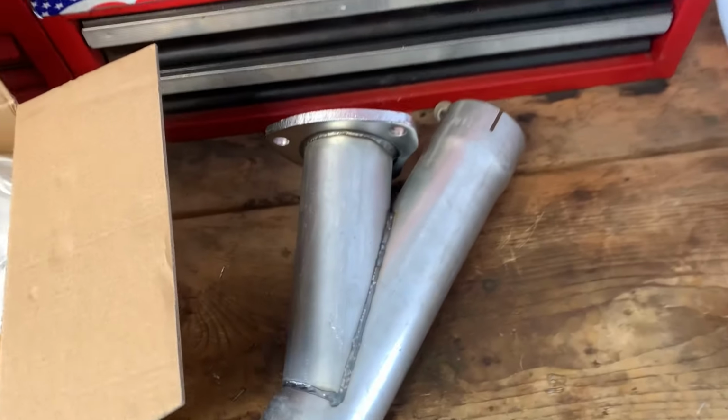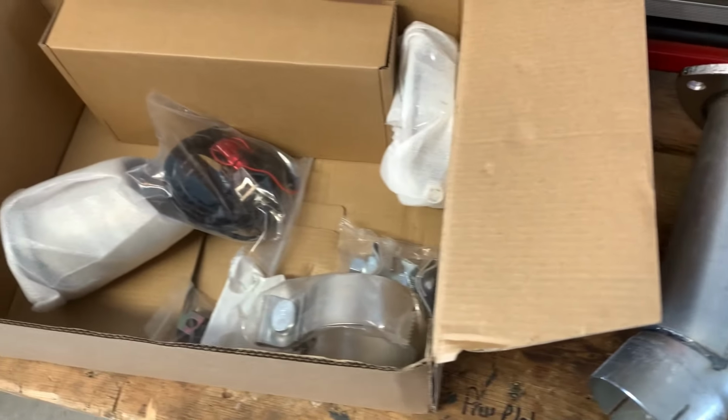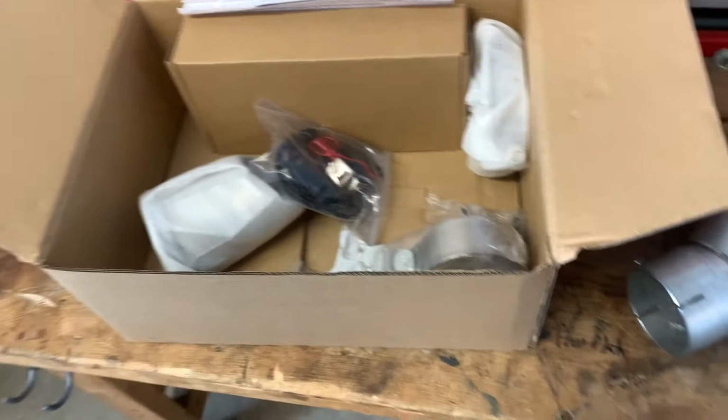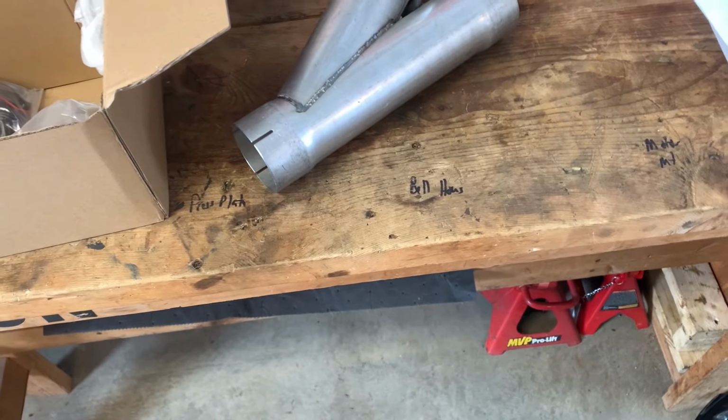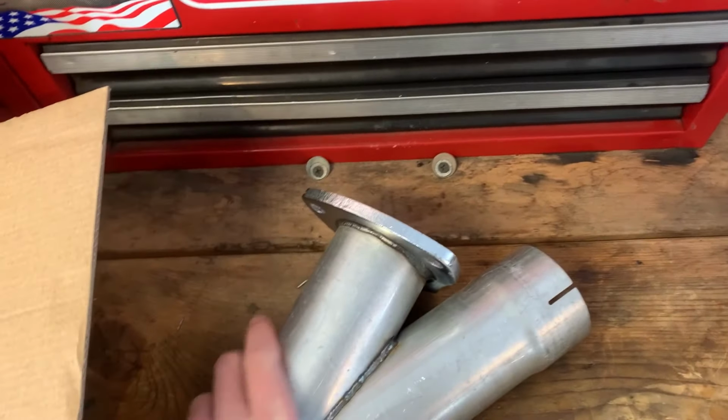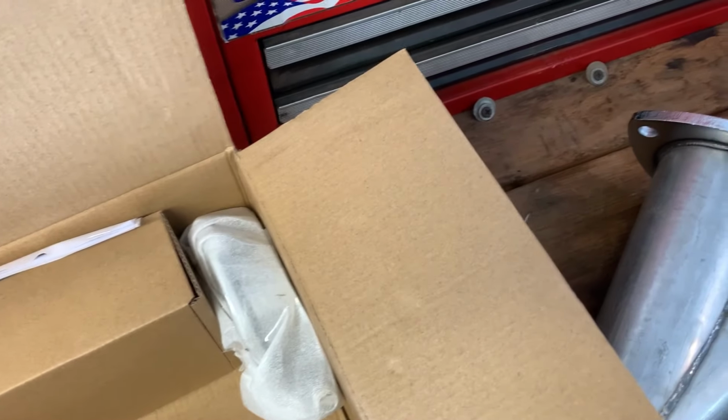And for mufflers, I'm going to run Thrush welded, 2.5-inch in, 2.5-inch out. I think it'll sound really good. I want a more muffled tone, so it's not extremely loud whenever I'm driving around, because it's going to be my daily driver for a little while before I buy something else, so I don't want to blow my ears out. And then whenever I do want to make it loud, I'll just flip the cutout switch there and she'll be in loud mode.